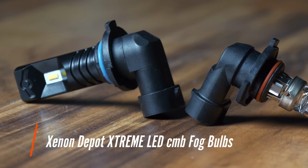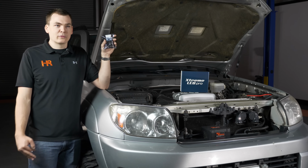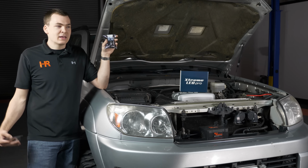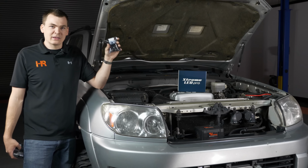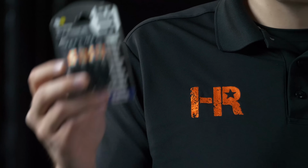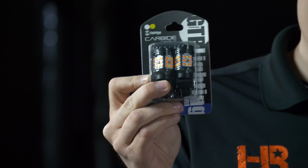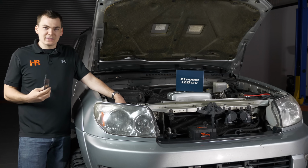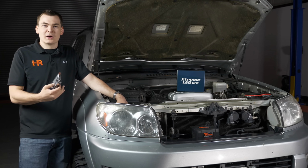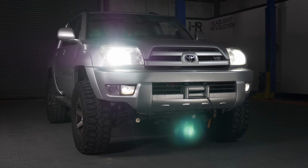We just did a big tabletop review on these where we show them in different fog light housings, Ford fog light housings, Chevy fog light housings, and in this video I'm going to show you guys how they look in the Toyota fog light housings. While I'm down there, I'm also going to install the GTR Lighting Carbide Canbus 2 bulbs. The cool part about them is you don't need to do a resistor with them. So on a vehicle like this, you'd have to lay down there, solder some wires, mount a resistor to the frame somewhere. That's no fun for anybody, and that's not what we're trying to do here.